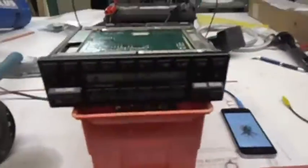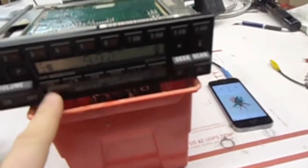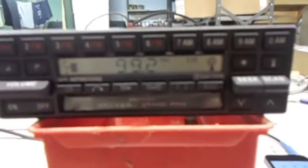Alright, so I have it wired up. Normally you could put a tape in, and that would activate the tape deck, and then the line in. That's how it comes in. It comes in through the circuitry for the tape. So basically the tape deck is inoperative, but I have it hooked up so where you can push the button, and that'll trick it into thinking there's a tape. It's explained in the thread. Honestly, I think at this point I'm not gonna open this thing totally up to show it.